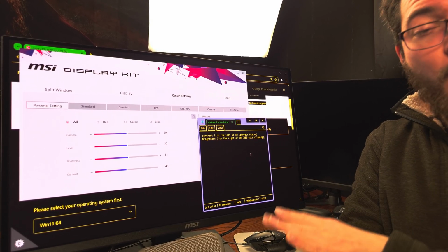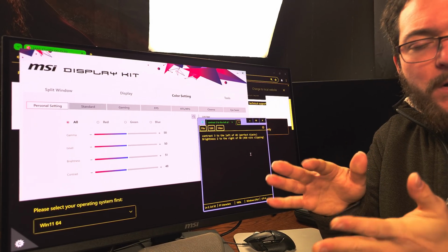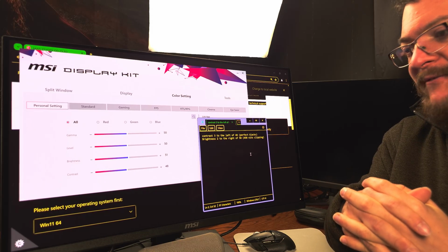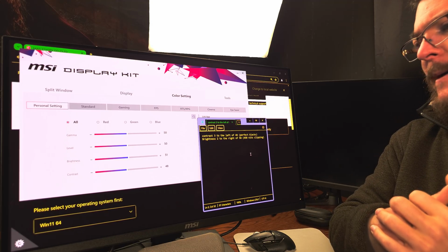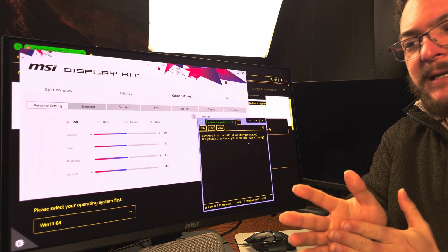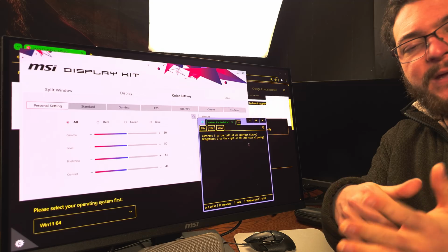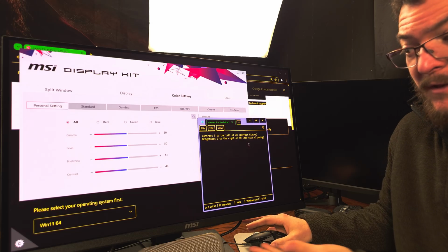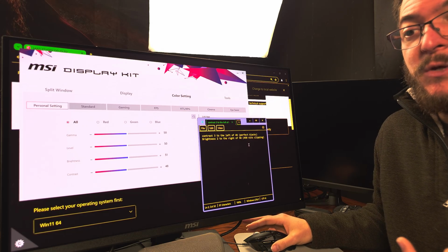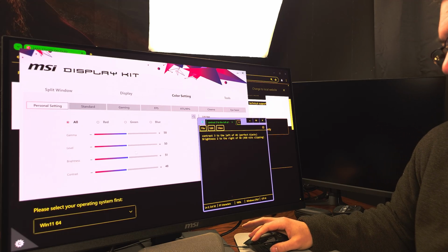Now these settings are for the HDR 400 nits mode, which is actually close to 450 nits. I do not have an instrument to measure what the actual brightness is, but I target 450 nits. So basically, the games or the HDR calibration app or any video that you open will be clipping at 450 nits with these settings. I don't think it should be different with a different unit, but test it yourself using near black test patterns and white clipping test patterns, okay? So what I did here was basically the contrast setting.